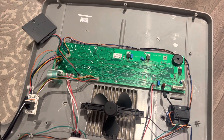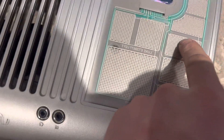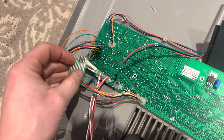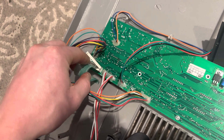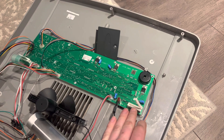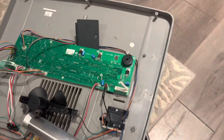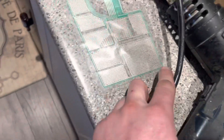After I did that I still hooked it up and it wasn't working — I was like, man, what's going on? So I ended up peeling the buttons off and took a look. This one looked fine. What I did was leave this ribbon connector plugged in. By the way, you can release these ribbon connectors — don't be scared. Take a look at them, make sure they're clean, slide them back in fully seated, and recrimp it down. I disconnected one side because the buttons didn't look right, and as soon as I plugged it back in I could control the treadmill with that side, which showed me that the other side of buttons were shorting out.